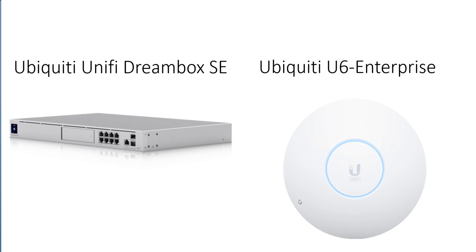On the left you've got the Ubiquiti UniFi Dream Machine SE — that's the brains of the operation where you do all your configuration. On the right is the Ubiquiti U6 Enterprise, which is where the Wi-Fi signal is sent out. You might wonder why U6 rather than U7. A U6 is Wi-Fi 6 standard and U7 is Wi-Fi 7. The YouTubers I spoke to said stay away from U7 at the moment — the firmware is dodgy and performance is worse. Also, many of my devices like ESP32s only work on 2.4 GHz, and the U6 covers both 2.4 GHz and 5 GHz bands with no firmware issues.